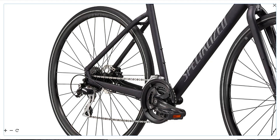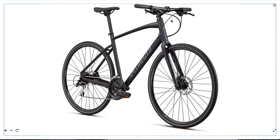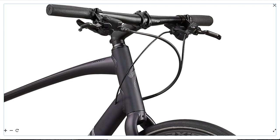Now let's talk about the cockpit. This is a terrific cockpit — it has the 31.8 stem and handlebar combination in comparison to the 25.4 older style. This combination creates a very stiff handlebar, which is great because you're much more efficient when you're not wasting energy by flexing the handlebar. Older 25.4 handlebars actually suffered from this for a long time. About the grips — they are very basic and nothing special. If you're looking for a much more comfortable grip, I'll leave a link in the description to my favorite ergonomic grip. I've been using these for years and they're actually more affordable than the Specialized ones.